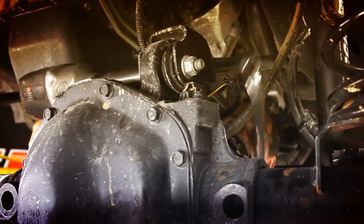We'll pop this locker line loose from our control arm. As long as we're here, let's just take that upper control arm off — that's going to be 18 millimeter again.